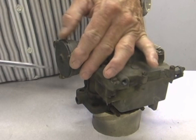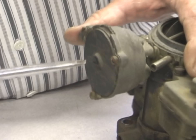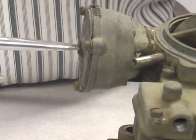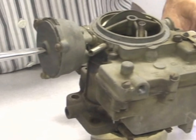Make sure the cover is loose because sometimes you loosen the screws and it's stuck. You can see this is a customer's carburetor — somebody has broken out part of the Bakelite cover over the years. In order to get the idle screw off the fast idle cam and loosen the choke flap, you have to open the throttle just a little bit.